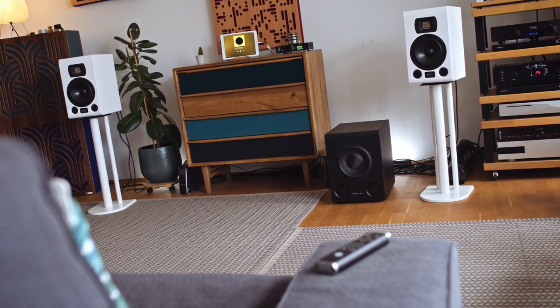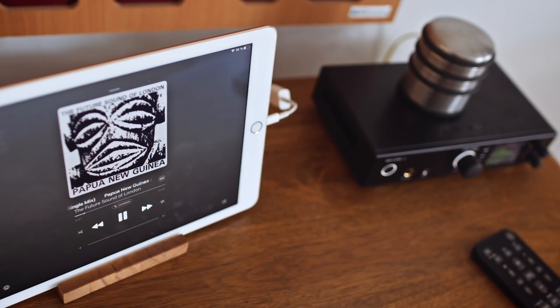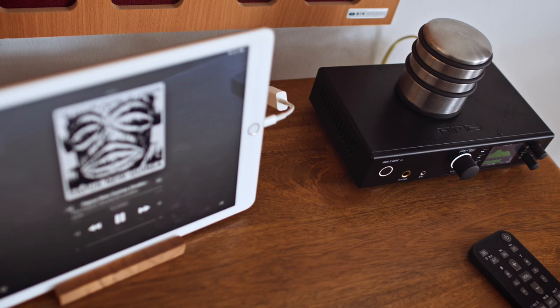And I also think, again, as per the loudspeaker differences, the HEDD system would work better in larger rooms than the KEFs. So if you don't like the fact that the KEF system is a completely sealed system, well, there is an analog input on the back of one speaker, but it does feel more closed off and everything's very much app-based. If you want to break out of the app world, and choose your own DAC and your pre and your phono stage and things like that, the HEDD give us much more flexibility in that regard.